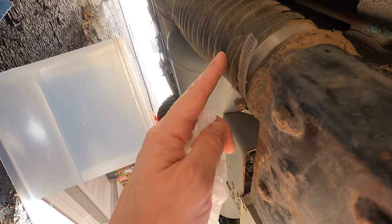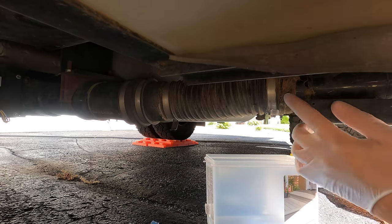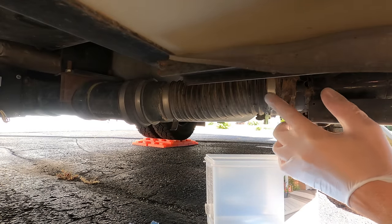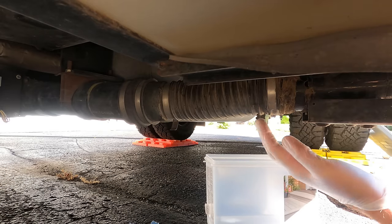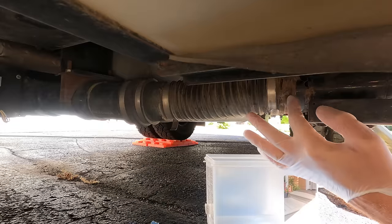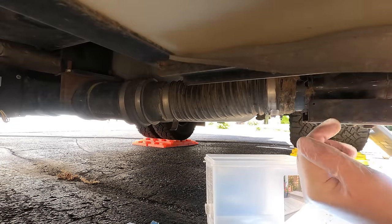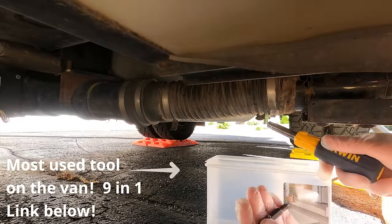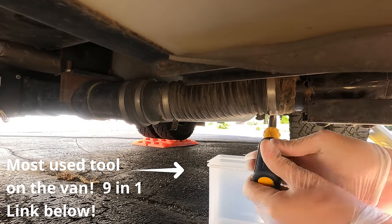And also this is where all of the liquid is gonna drain out, hopefully into your bucket and not make a big mess. There's a bunch of silicone inside of this large hose here, which helps seal the connection because it's kind of ribbed. And once that silicone breaks, that's when the liquid starts to come out. You can also use a nut driver for this instead of a flathead. If you have that, it's a little bit easier.